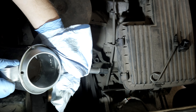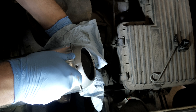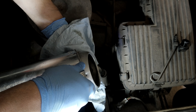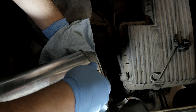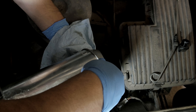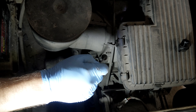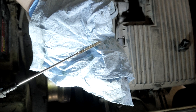Start your threads — these are fine metric threads, and fine metric threads can be a pain to get started sometimes. It's touching, so I give it a couple of light taps just to make sure it's seated. Nothing hard — you don't want to go nuts whacking it or you'll strip it out and be helicoiling.